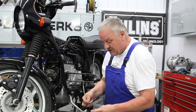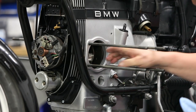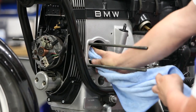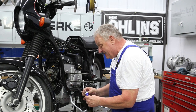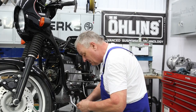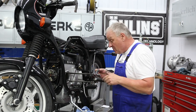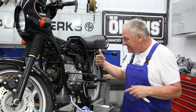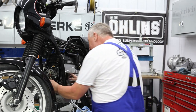We can push the new rod bearings into place. On the crank journals, ensure absolute cleanliness — I know it's all been cleaned, but still give it one more careful look. Now I'm going to put a little bit of this LM48 on the rod bearings as well, just so it gets initial lubrication until oil pressure is introduced. Take the small end of the bearing with the pin holes facing forward and lay that onto the crankshaft. Then reach to the other side and push on the back of the bearing with a piece of wood — a wooden dowel makes things a little bit easier.